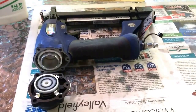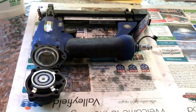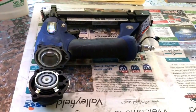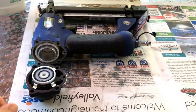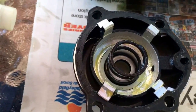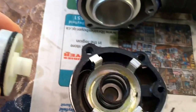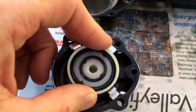This will probably be the typical situation if you own one of these nailing guns and it hasn't seen much use and you're trying to use it and it's dry firing. What they explained to me is that since it's been sitting on the shelf for so long without being used, the lubrication in the gun has dried up. If you look down into the back here, you can see that the oil that was once in liquid state has turned to a petroleum jelly, and that is not good enough for lubricating and creating the proper seal that you need on these nailing guns.